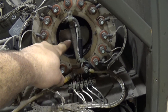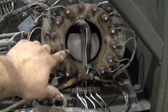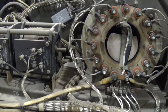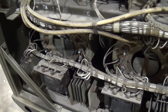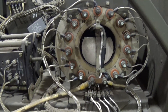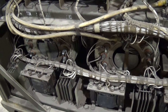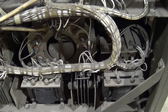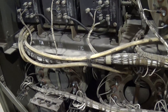Each fan has a little device called a wind switch. It will not let you energize the heating elements unless this switch is being drawn in by the fan, to indicate that the cooling fan is running. I've just been probing around on it — I haven't even put power to it yet. The wind switches work properly. The windings in the fan motors are not open circuit; they actually measure exactly 50 ohms. I think that's a precise enough number to not be incorrect. I've also got three rectifiers in here.